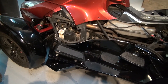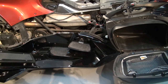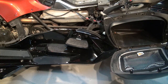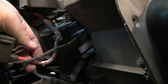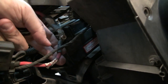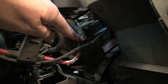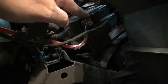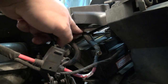Isn't that beautiful — we've taken off the side panel without taking off the mirror and the front panel. Where there is a will there is a way! Approaching the bike now — you can see that your positive terminal is right there. It's going to take a 10mm socket to take that out, or you can use a star screwdriver, but go ahead with the 10mm. Just remove that and that's going to be the positive wire terminal we were talking about.